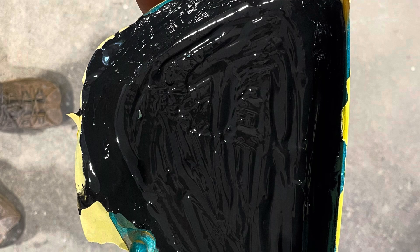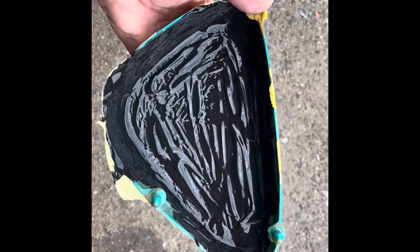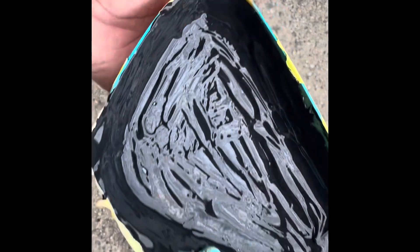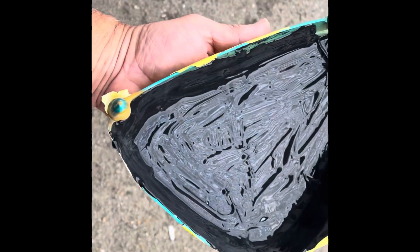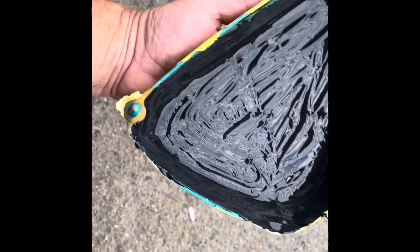No, it's not thick — more is not always better. Sorry I wasn't able to do a video with this thing, but I didn't have my stand there with me. What I've done is just a thin coat of the 3M panel bond after I taped it up and made like a mold of where it's at. That right there will dry and I'll have to trim it off and put some more on it — because see, that right there is completely made with panel bond.